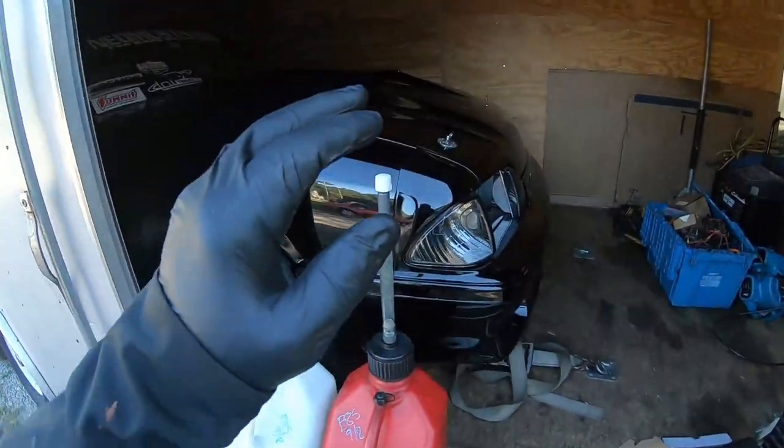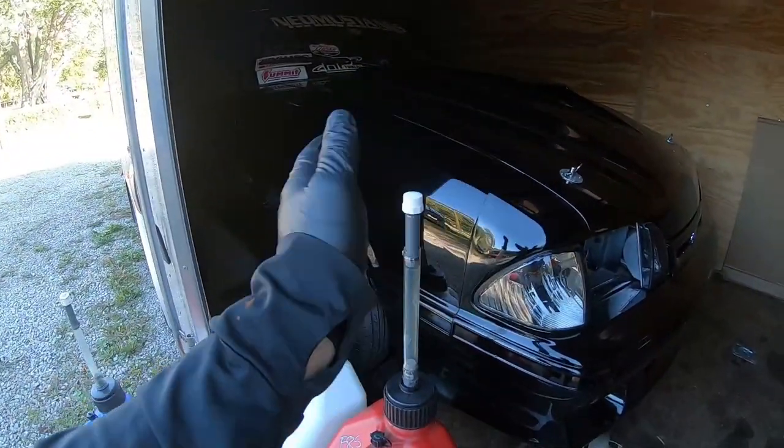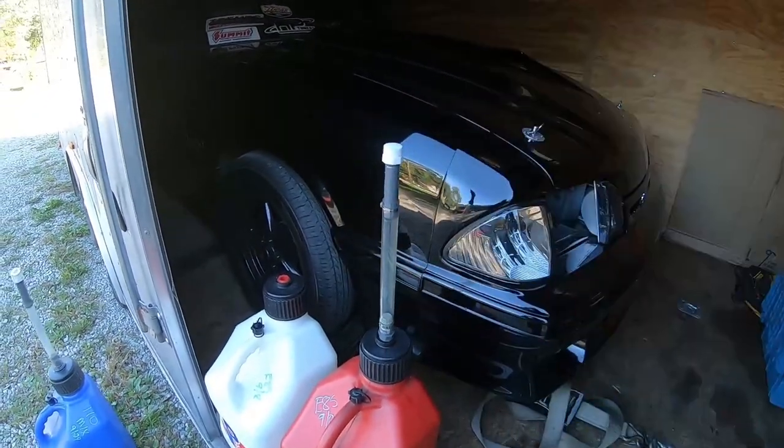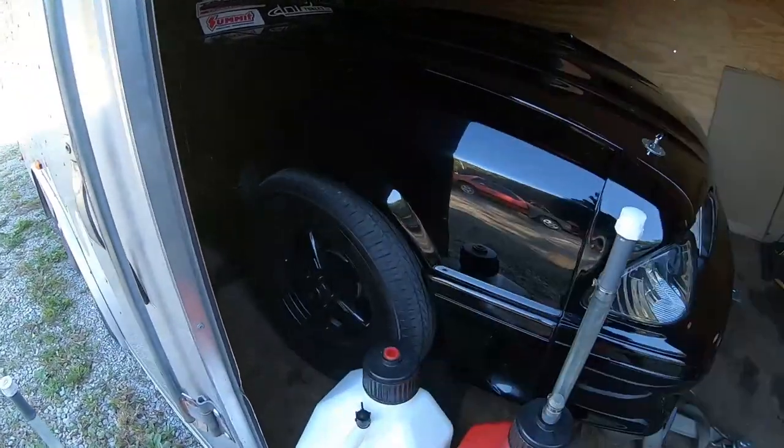If you followed me thus far, you know I've been doing a lot of TKX testing with the transmission. So we turned the car down a little bit, made 600, 650 wheel. But one of the problems that we're having is the car going down the track is doing a lot of swerving. So I want to get underneath of the car and check the control arms and the bolts and such.